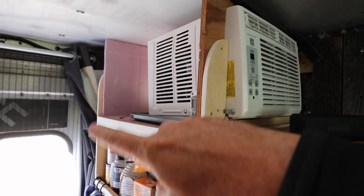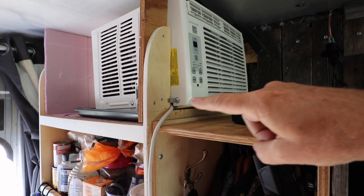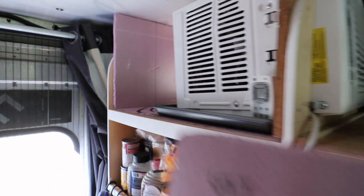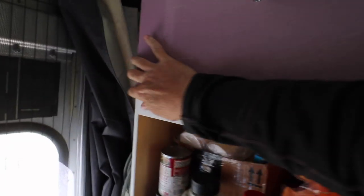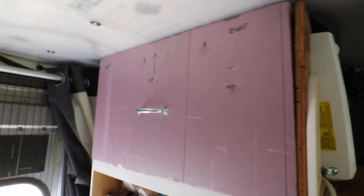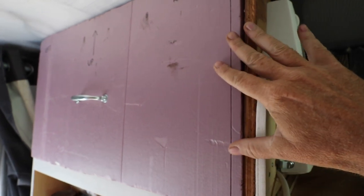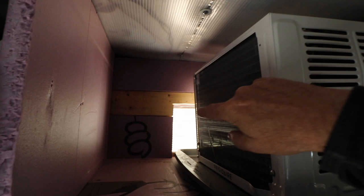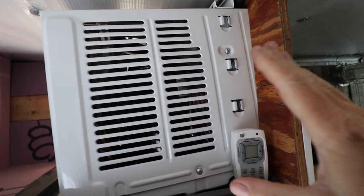In the last episode I shortened this shelving unit here, which you can see all my supplies on, so that I could put the AC unit on top. I cut a slot so that it can fit inside the box, and then I created a foam door that goes here, which I labeled with left, right, and up, and put a little handle on it so I can insert it and seal this off. The vent on the outside allows air to come into this box, which is foam-filled on every side except this side, and the AC is mounted at a slight angle.